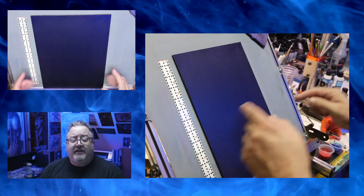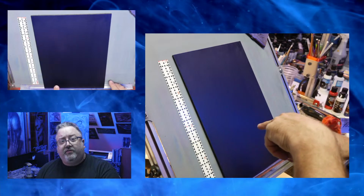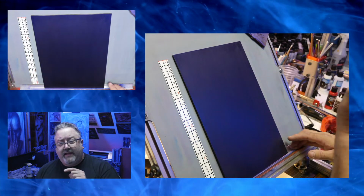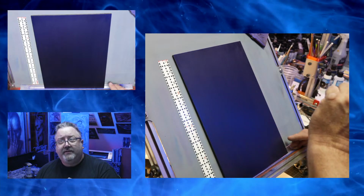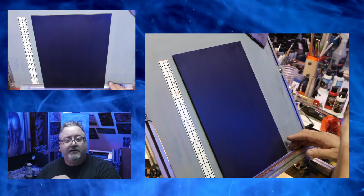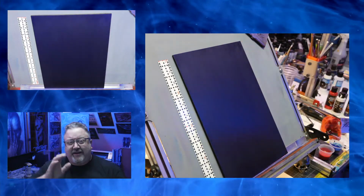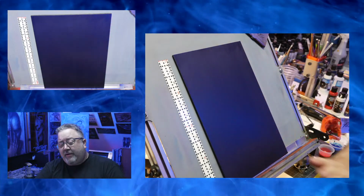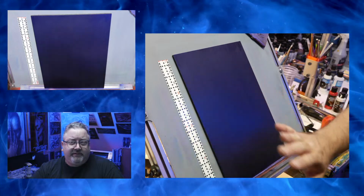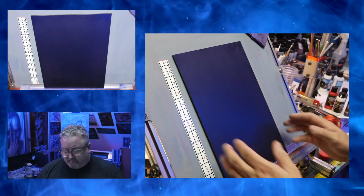And what I did is I sanded this with 400. I did 2 coats of black with a little bit of blue sealer, waterborne sealer, and then I did 2 coats of the Sparklescent Pearl, and then a coat of straight 40/50 to lock it all in. That way it has something to scuff to, because I don't like scuffing directly on pearl. This is something you don't have to do. This project would work perfect on a dark base coat. You know, just a black panel would be fine. I just wanted to do something a little bit different.